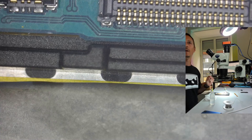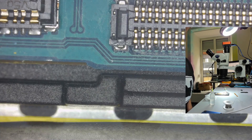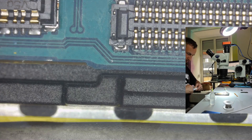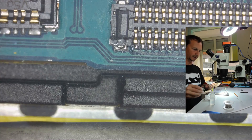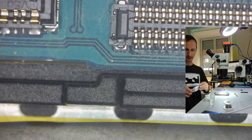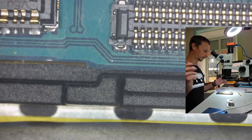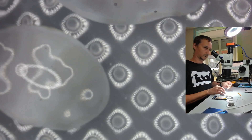Now we're going to add a tiny bit of epoxy because this is going to dry fast and hard. Basically the repair here is only an issue with the FPC connection — there's a bad connection, so the resistance isn't right anymore and the phone thinks there's a heating issue. So let me mix that up.